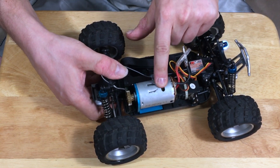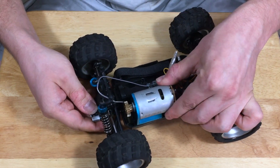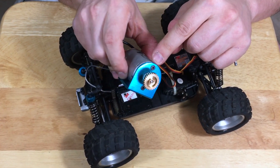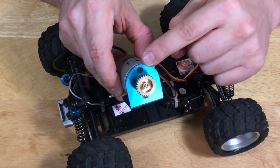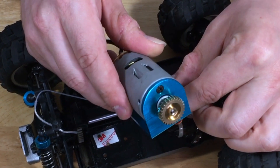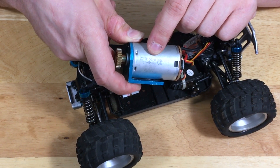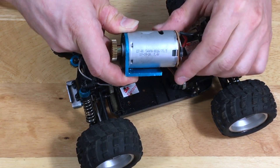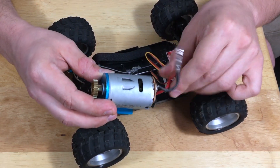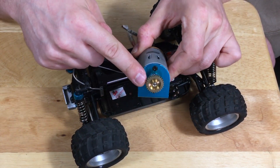The motor is mounted pretty straightforward — just four motor screws on the bottom. I already removed them to make this video faster. So there it is: a standard motor mount with a regular 540 motor. There's a distance of one inch between the center mounting holes, which is standard. Interestingly, the motor is date-stamped 7/9/16 — so it was manufactured about a year before I purchased it, which I've never seen before. It doesn't say the amount of turns, but it's fairly fast — probably a stock motor. The speed really comes from that giant pinion gear.